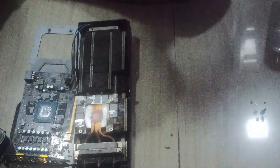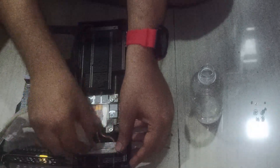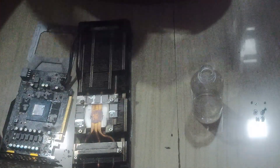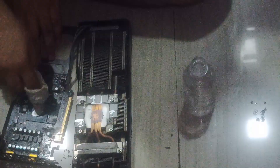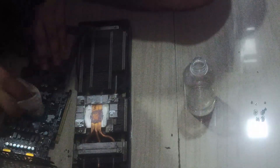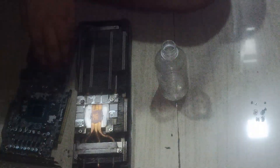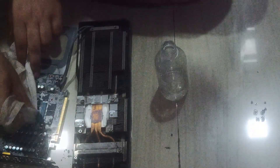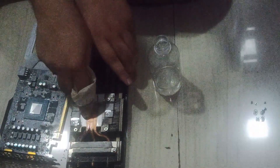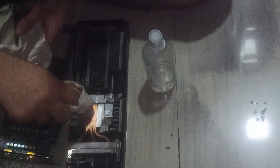It's fine. Should I do one more? I don't know, let's just do it. Now just focus on the GPU — as you can see the thermal pad is clean, very good. It's going to require some time. Use a very good amount of isopropyl alcohol. Now just clean from this side. Let's move it a little bit so it cleans properly. Now close it because I don't want another accident.